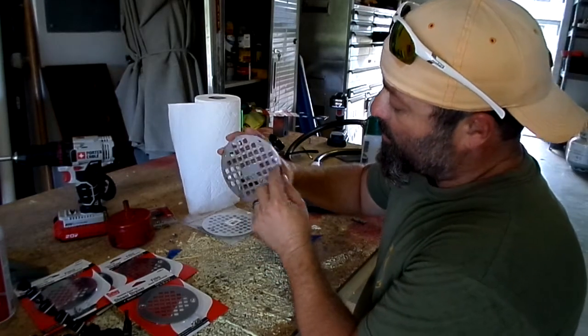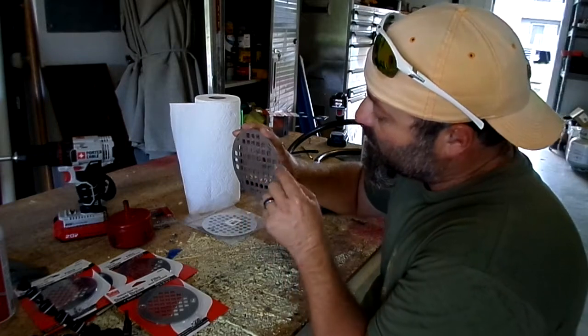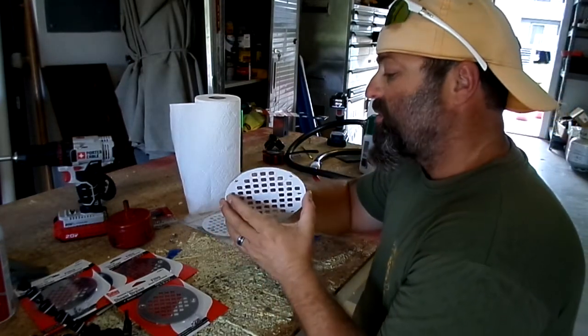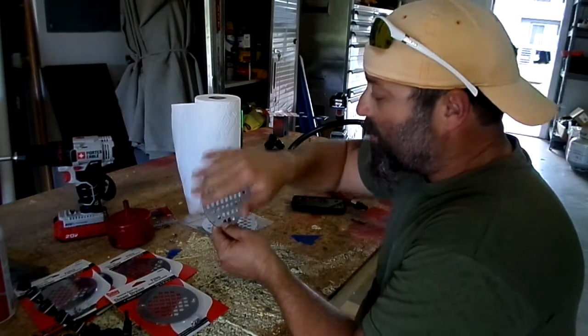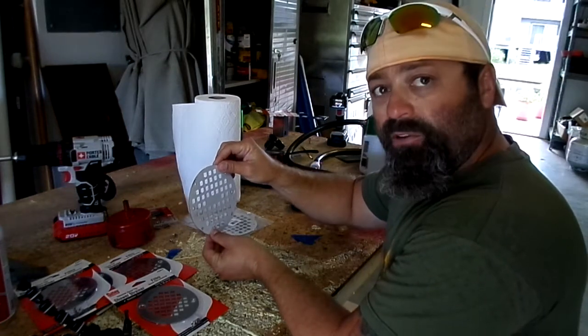You just want to get a little bit wider drill bit, and just for a crotch hair, countersink that hole. That way those two little nipples will sit flush inside, which lets everything sit flush. So when you screw it in there, there's not going to be any movement.